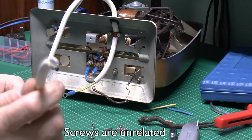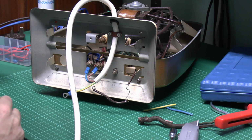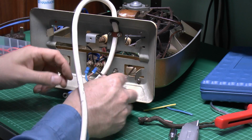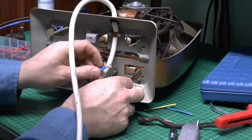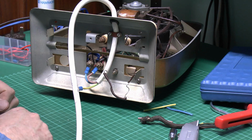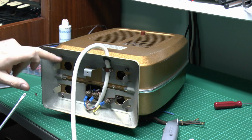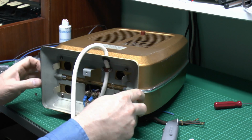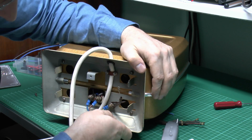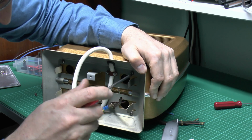Now this side also will put a new plug on there later, but for the moment what we need to do is to reconnect that earth wire. And this has got two connections. It's got the one which goes onto the stud there, and then obviously that will go on the top, and then there's this other piece here which fitted onto the other side of the casing. So I'll just put the rear cover back on, and that's just the two screws at the top here, and the chrome trim on the side just comes underneath through here and is basically just clamped in position there, so just a question of making sure that's pressed in while tightening up the final screw there.